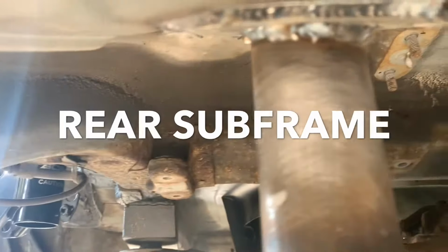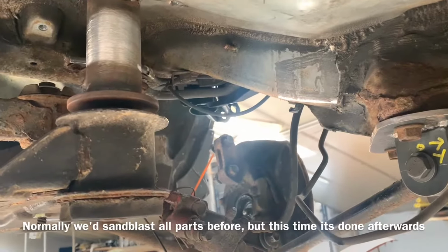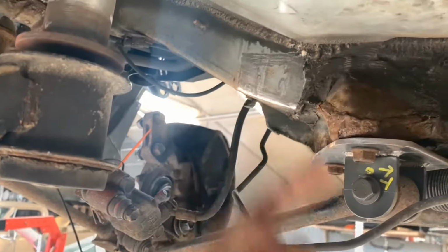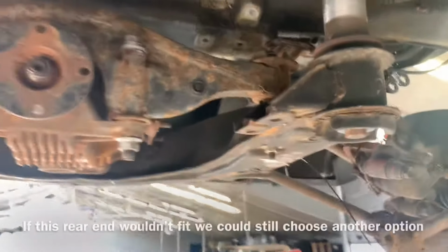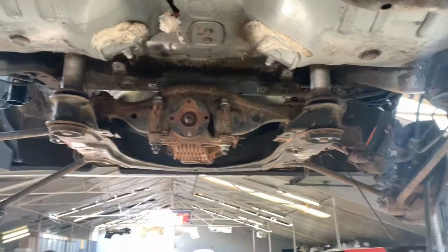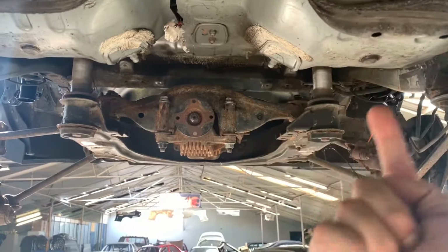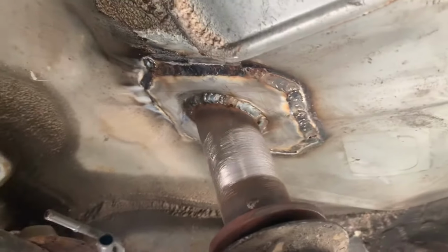That's where it's gonna sit, right over there, connecting this subframe pickup point to the chassis rail over there. We measured the thickness of this rail and it's thick enough for us to directly weld on. If it were thinner, we would probably weld a 3mm piece on it. So we want to connect these two pickup points to the chassis rails because this is just underbody floor, 0.8mm thick. So we welded the plate in there.